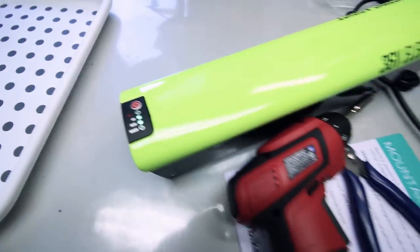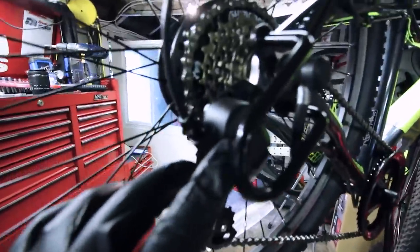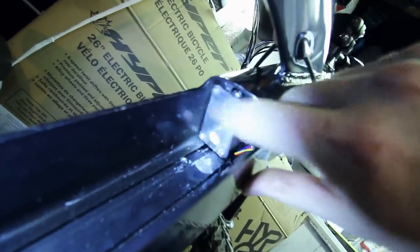The battery came pretty much discharged as expected, so I went ahead and charged that. You have to charge it in the on position on the battery itself — I'm assuming that livens up their battery monitoring system and brings it online to balance the cells. Before even riding, it was clear that the derailleur at the back was set way off. No wonder people have problems with the chain staying on in some of the reviews. Easy fix, though it's beyond the scope of this video — I'll post a link below to a video that'll help with adjusting that. Inside the frame, above the battery with one of the covers removed, is the controller box that does your speed control. This was the only major shortcoming I found: there was no mounting in here and it was just banging around. Easy fix — I just used some of the packing material from the box.